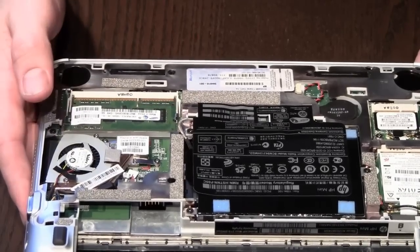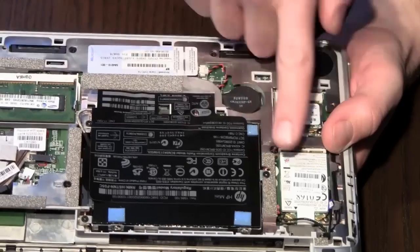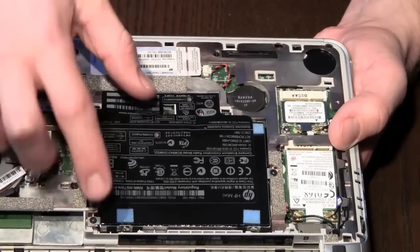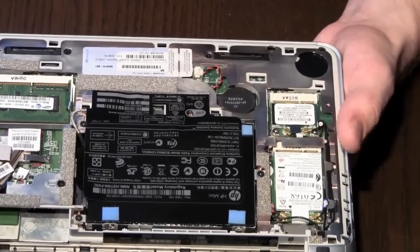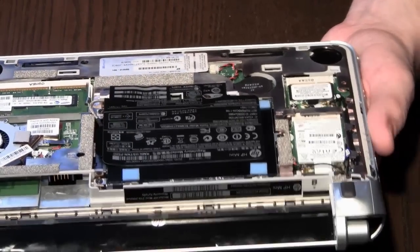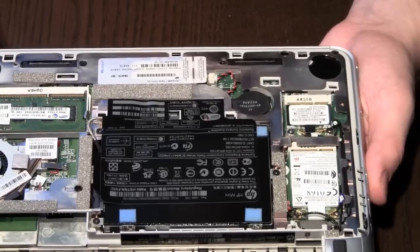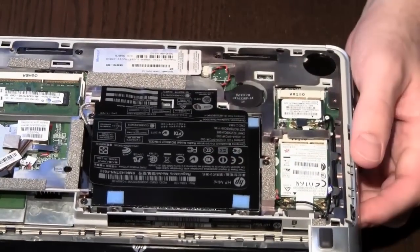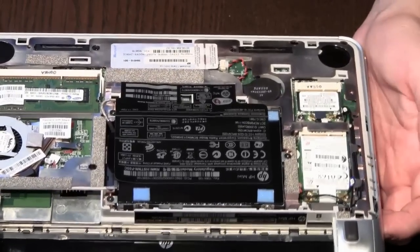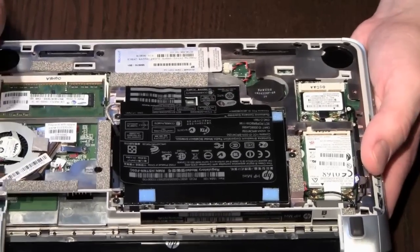The chip it comes with is a Samsung, so maybe it's just a problem with the manufacturer. Back to the hard disk — I replaced it with a solid state drive. You just unscrew the hard drive, peel the sticker off, the whole thing comes out, disconnect it, and unscrew the hard drive from the tray. You can put in any 2.5-inch hard drive you fancy. A little side note: be careful with reinstalling Windows because you can't just make a recovery CD of the original hard disk and use it on a different-sized drive. It comes with 250GB standard, and I couldn't get the recovery disk to work with the 64GB solid state drive. After contacting HP it turned out to be because of the size difference, so I did a fresh install of Windows to solve that problem — make sure you are aware of that.